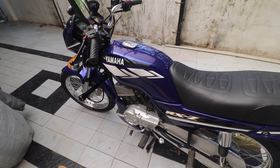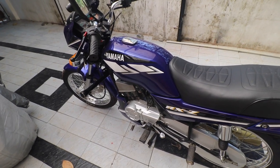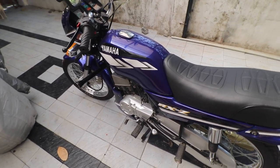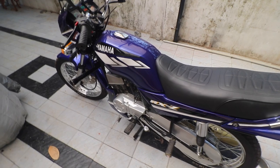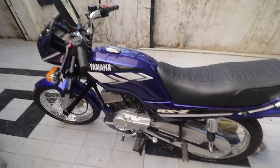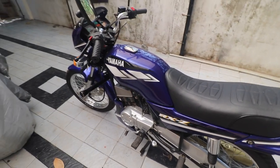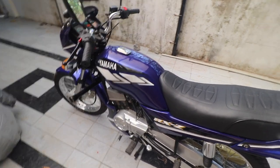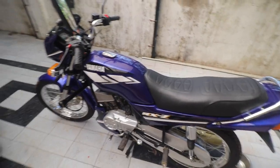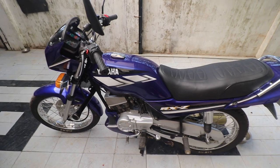The quality of petrol is not that great in India, and in Kerala the quality is pretty pathetic. Apart from that, there is a good amount of rust in most of the bikes because the newest bike is at least 15 to 17 years old. So it is advisable that you clean the carburetor every now and then.